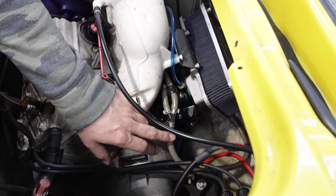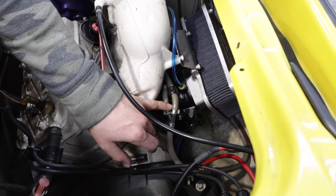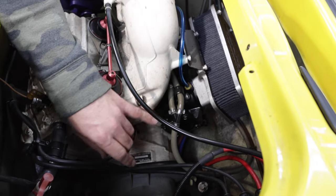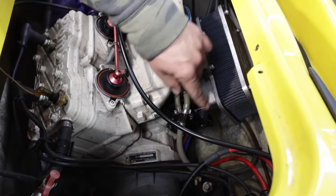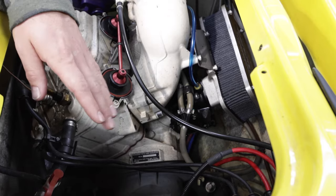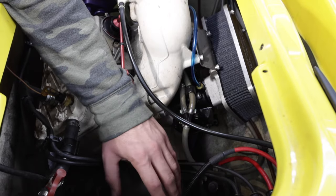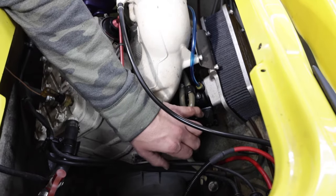Your next maintenance item is to check these fuel lines. This is a new-to-us ski and nobody's done these lines before — if you feel them, they're very brittle and hard. These are gray lines, and gray lines over time, because of ethanol fuel they weren't made for, create a green goo when they meet the brass part of your carbs that clogs them up. If you have gray lines and it's wintertime, replace all of them — take them off one for one, cut them the same length, and put them back on. If you have gray lines that have already been run, you should pull the carburetors and rebuild them. We have an easy DIY rebuild video on our channel.